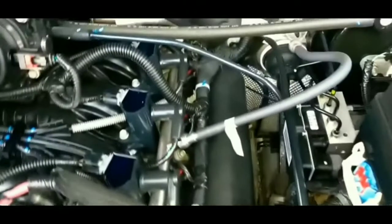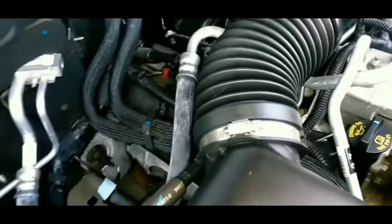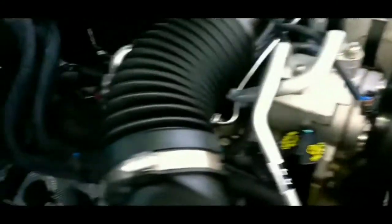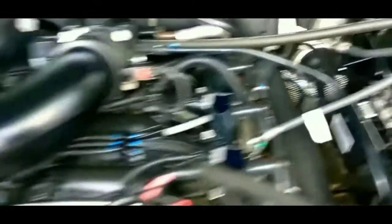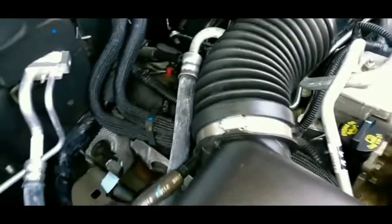The terminals were a little bit corroded. I hadn't cleaned them in a while — there was some whitish debris on them. I had a can of Coke in the car, poured it on the terminals, let it fizz up and oxidize, then used some napkins to clean it off. The terminals weren't loose but I tightened them up. I was hoping that would resolve the issue, but when I tried to start it again, it still cranked and wouldn't start.